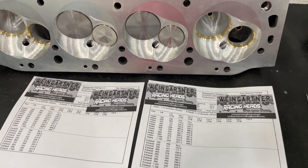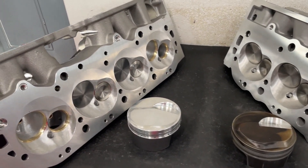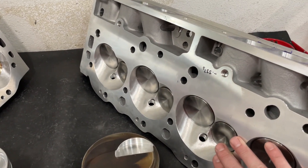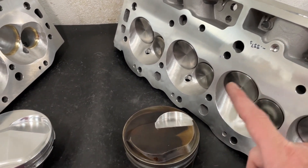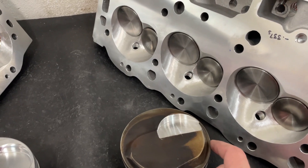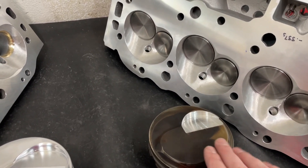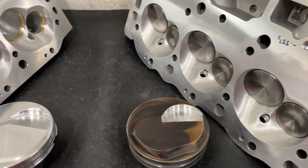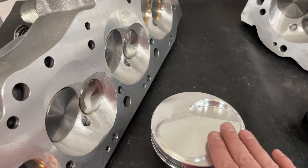Let's get to the pistons. Here are the heads side by side: the BRX with 20-degree valve angle and 106 cc chambers, versus a typical AFR 305 I ported with 119 cc chambers. This is the piston you'd run with the AFR and this is the piston to run with the BRX. A couple things to keep in mind: this piston I used in a 540, and with this dome and that chamber, it yielded 11.5 to 1. With this little dome on a 582, it's 11.2 to 1.